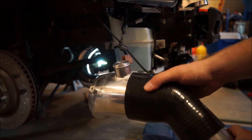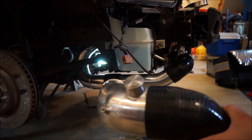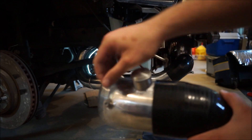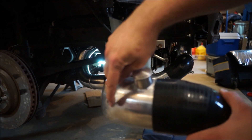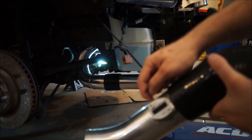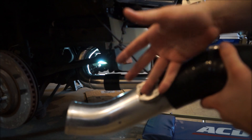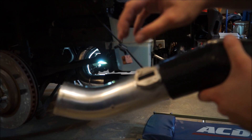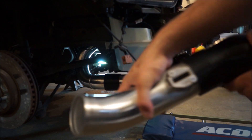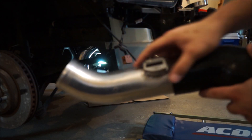I also want to mention the modifications I made to the cast piece. I put a press-fit plug in here — you could use a sloppier one and have somebody weld it in — and I epoxied it as well. I put a plug with sealant in another port, and I had a buddy weld on a MAF flange here. This lets me get accurate intake air temperatures post-intercooler so timing corrections are based on actual charge air temperature rather than ambient air. I also put an air straightener in there to get a cleaner MAF signal.